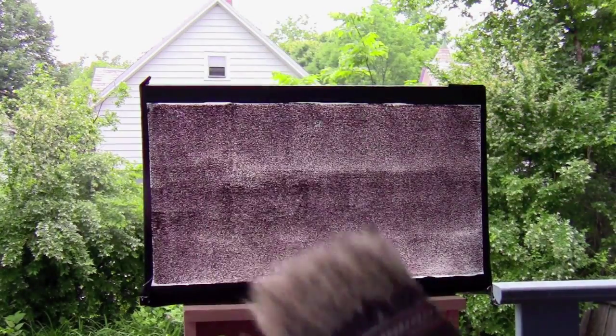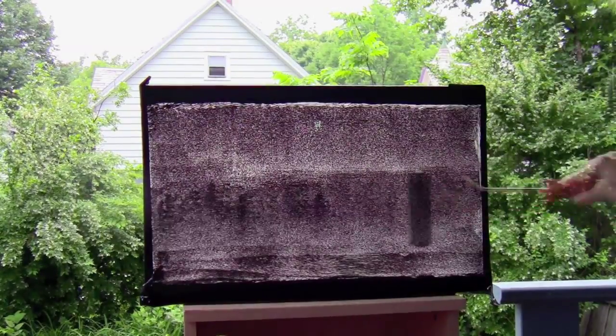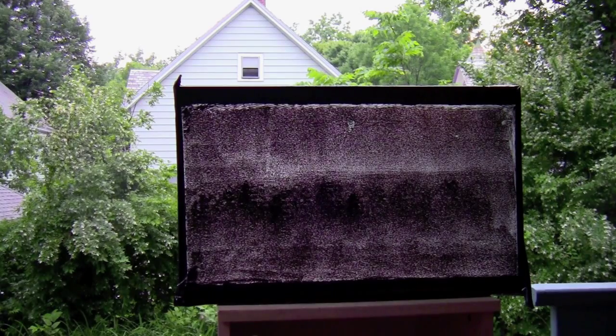Use your small paintbrush to get around the edges and into the corners. Now we're going to wait for this first layer to dry and come back and do a second. It's been about an hour and the paint is pretty much dry — still a little tacky, but we're losing daylight so I'm going to go ahead and put the second coat on. For the second coat, you're going to go the opposite direction from the first time. With each coat just keep doing that — keep coating the tank until it becomes as dark as you want. Put it under a nice light and make sure you can't see any light through the background.